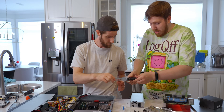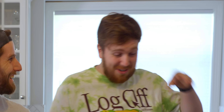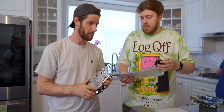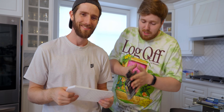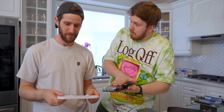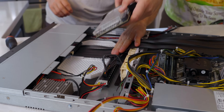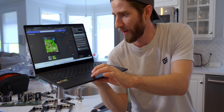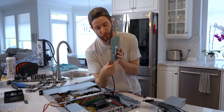I am gravely worried — this bracket was supposed to go in when we had a smaller motherboard. But actually, I am no longer gravely worried. What GPU are we using? This is still the placeholder one, a 3090. Do you have any idea what GPU you actually want in these systems eventually? Used 30 series might be the way to go right now, and I bet I could get cheap water blocks for them. One of the big complaints last time was that the GPU was upside down — you want the water block visible when it's in your rack. This platform lets us place the GPU and run the riser cable underneath so it shows up nicely when you open the case. Antoine from the Labs team sent us a picture of the block and backplate mounted to another board — his version came with the right mounting hardware, but we've decided to move ahead with the cheaper board due to cost.